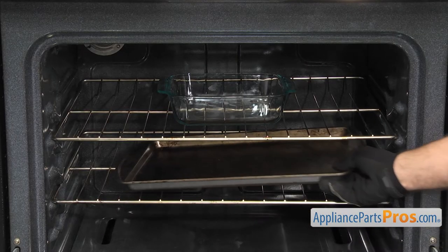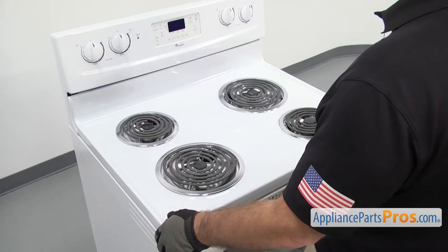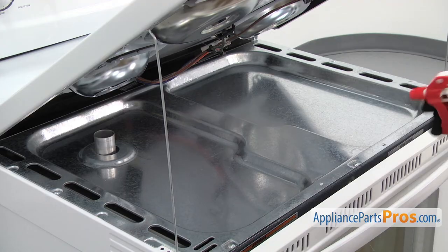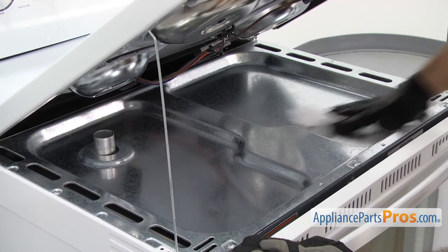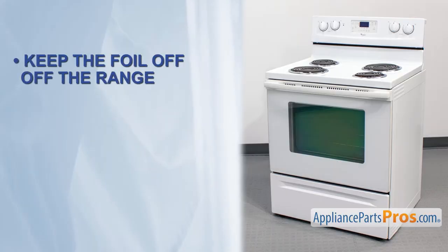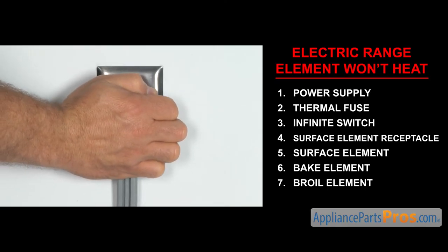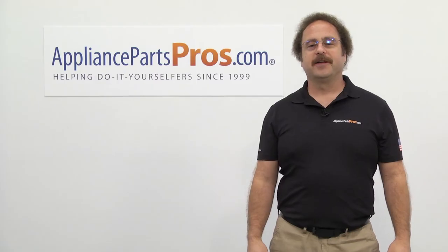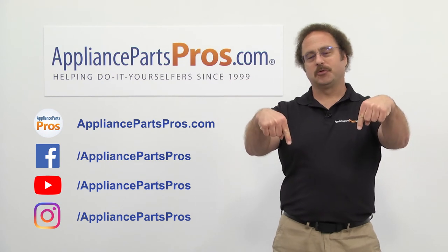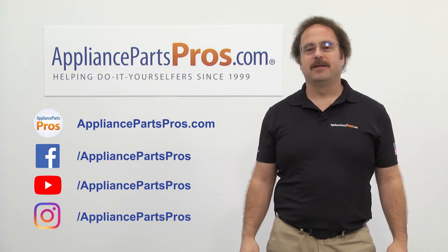You should only use a small pan on a rack several inches below the food you're cooking to catch drips. Due to these dangers, you don't want to use aluminum foil to try to keep the range clean. You should clean the oven and underneath the cooktop regularly to prevent grease buildup. So keep the foil off the range, keep it clean, and keep an eye on it while you're cooking. Once you take care of the problem, you can plug the appliance in and take it for a spin. Thanks for joining us for another troubleshooting video brought to you by AppliancePartsPros.com. Remember to hit the like and subscribe buttons, and if you have any questions or want to share how your repair went, leave a comment down below.